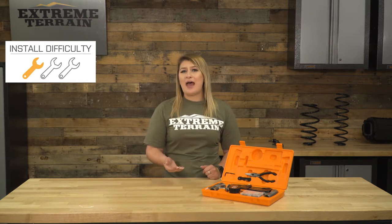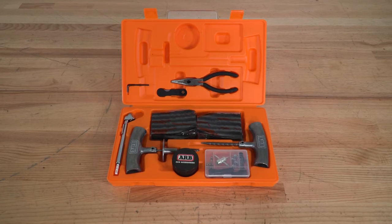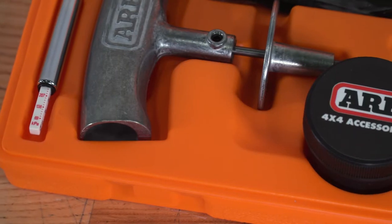Now, there's no install to this, but if you've ever plugged a tire before, you know that it's pretty simple, and if you haven't, I'll tell you more about the process in just a moment. This kit will consist of everything that you need to fix a flat wherever you may be. It comes with the tools necessary to puncture the hole and widen the bands in the tire, making room for the cord. It also comes with a tool to insert the plug as well as 30 cords, so this kit will last a long time. Even if you do run out of cords, they will be the only thing in this kit that you will have to replace.